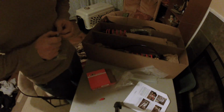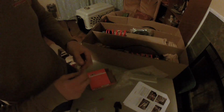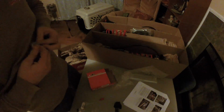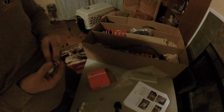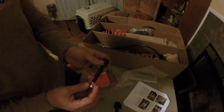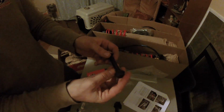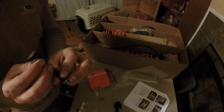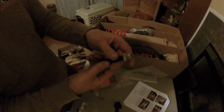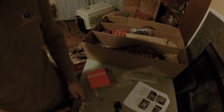Then a common issue I've run into is the cross bolts on these have, I believe, a 14mm triple square head to them. So I went with these, which is ECS's assembled replacement for them. So a heavy duty, I believe, essentially a grade 8 bolt and a locking nut. So basically that just eliminates the need for the large triple square.